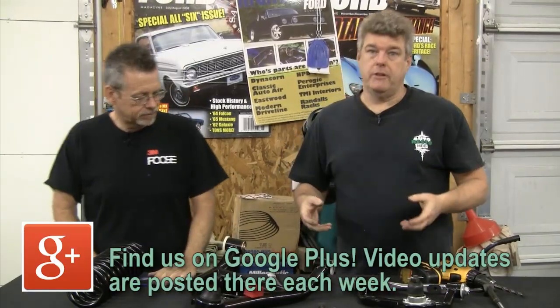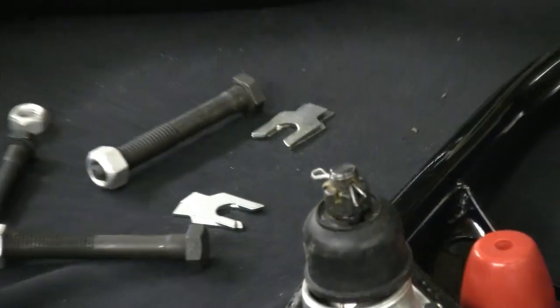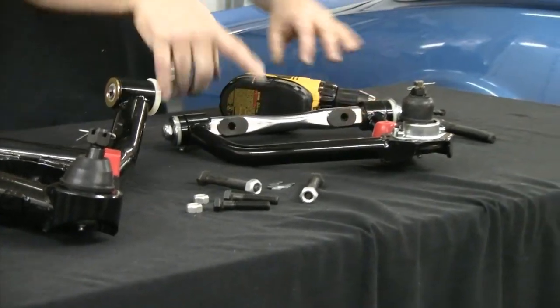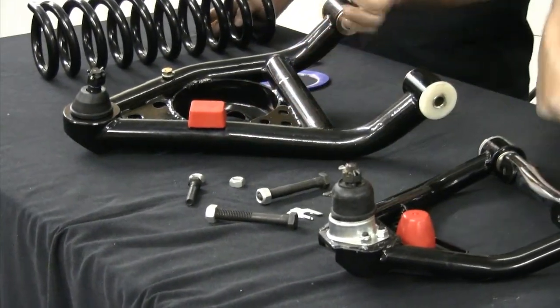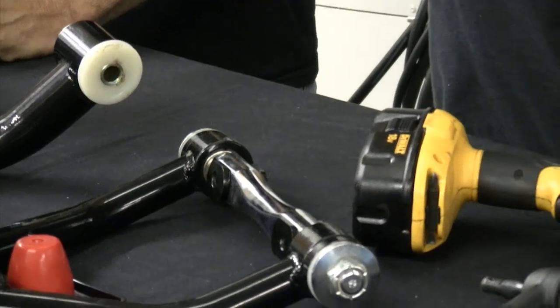What we've got here on the table is pretty much everything we're going to be working on this week. We've already done the driver side on the car, got it all installed so we can show you the best method to put this stuff in. We've got our hardware kit from National Parts Depot — if you're going to do this, spend a little extra money and get a nice hardware kit. This is all factory stuff with original-style bolts. These are the short-shouldered bolts for the upper control arm and these go through the lower. We also got an alignment kit. One main reason for using these is they're hardened — you want hardened bolts. The kit comes with an alignment kit for basic alignment setup. We recommend putting an eighth-inch of shims on the upper control arm as a basic starting point.